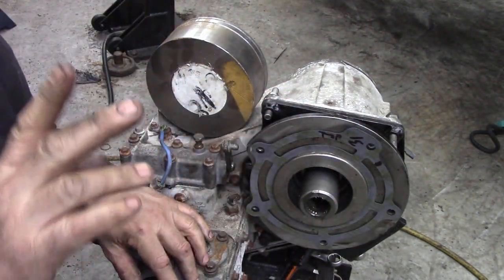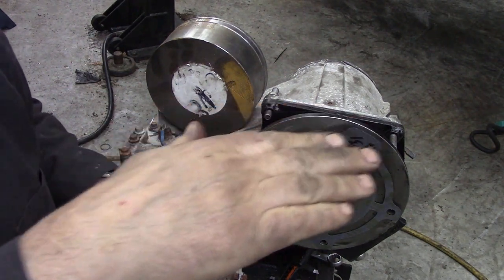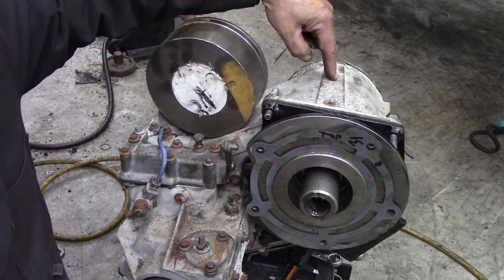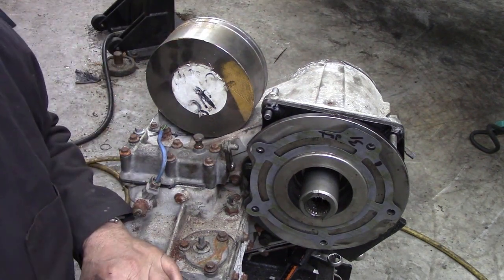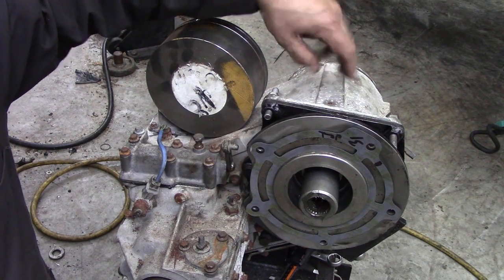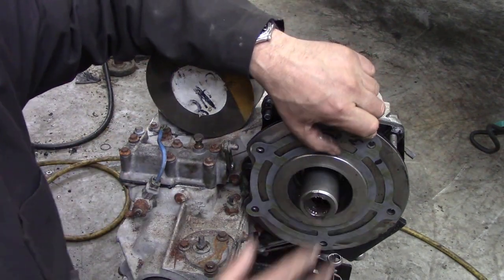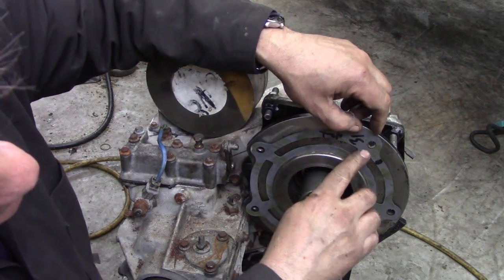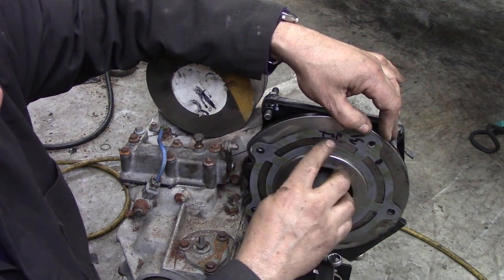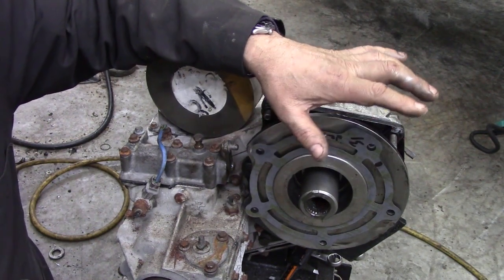When I had the engine out, I found a nice piece of the engine that was level. I put a spirit level on top of the engine — not this bit, not this bit, but this bit at the top is level and horizontal. I checked it on four or five different vehicles in the shop and came to the conclusion that when this transfer case is mounted, this is the level top. Once you've got a level datum to work from, everything's easy. I've kept this as a reference gasket with the orientation marked — the bolt hole is 31 millimeters center, and that's the top. This gasket can only go on one way.